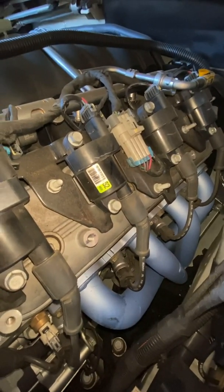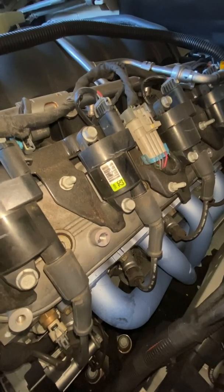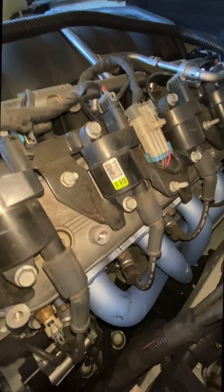That's a little bit more complicated than the coil, so that's not ideal. That's pretty much it from me today with this short video. But that'll give you a bit of an idea if you encounter a misfire on a VF on an L77 or LS3 — they're quite common on the VF2 redlines as well. That's a quick way you can self-diagnose the issue and save yourself a lot of labour. I know it's the injectors now, so I'm just going to go ahead and order a set of injectors and get them replaced.